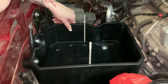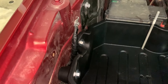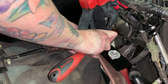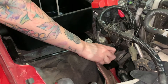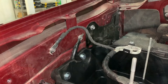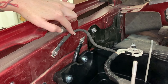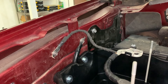After you've tightened down the battery tray and you make sure it's secure, you should notice that there's plenty of room for the secondary ground. Now make sure that the screw, nut, and washer are secured down. Remove the stock screws — you're going to reinstall them when you install the air box. We reinstalled the primary ground back in its original location, except this time the tab is facing out and the wires are going this way. We torqued down the stock bolt to 106 pound inches.